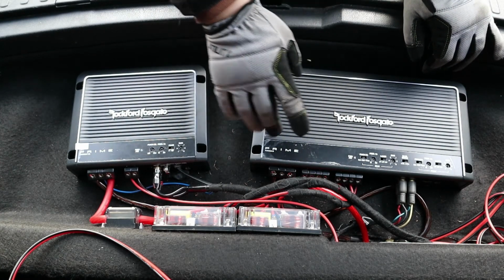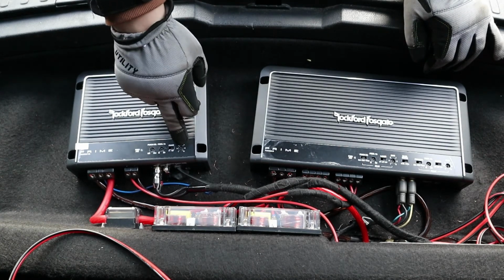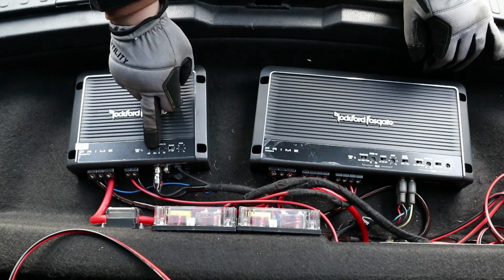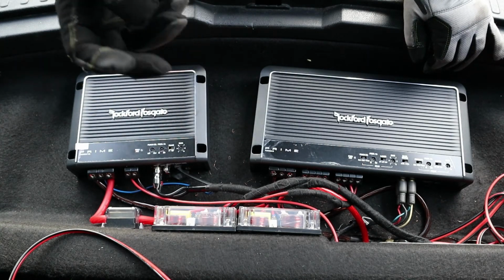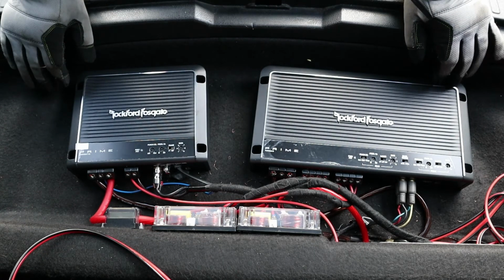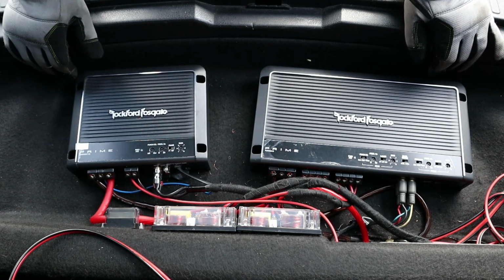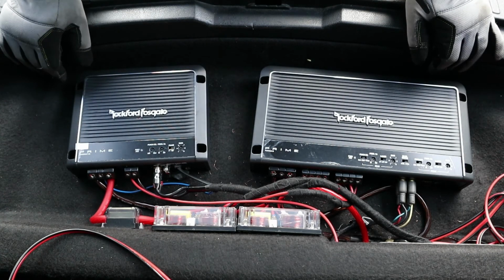When you're doing this, don't put all these amps and gains up. I know that you want to put the gains up to get the best sounding, but it'll sound like crap. From what I understood, you have to lower all this stuff down, and then little by little raise it until you start to hear a little whine in the speakers. Once you hear it, you stop. Just go back and lower it. This way it goes away and your music sounds clear. It may not be as loud as you wanted, but you get what you pay for.